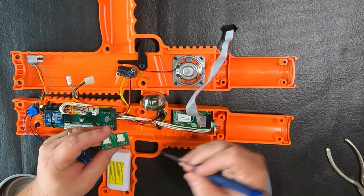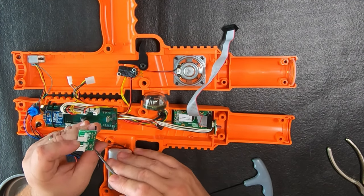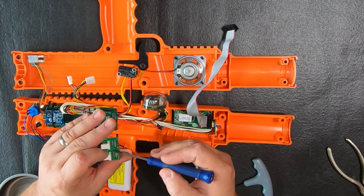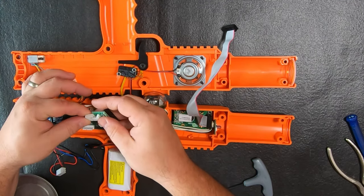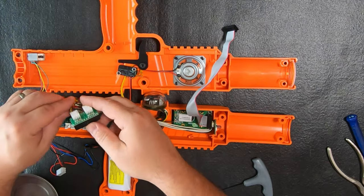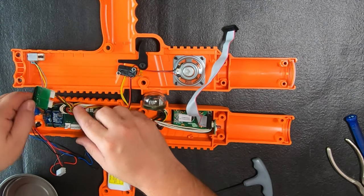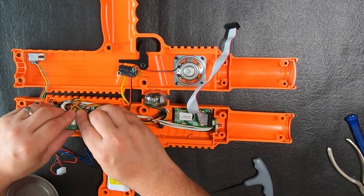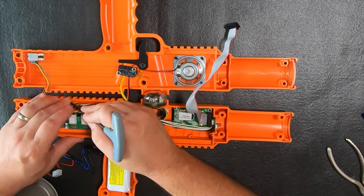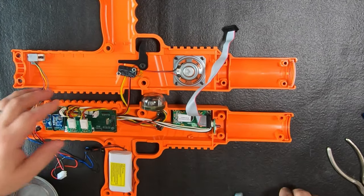Now I'm going to take my daughter boards and use my flathead screwdriver to very gently push these little resistors so that they're inside the box. This should have already been done for you, but double-check that the resistor is inside these little white boxes. Once it is, we're going to gently plug in the gun sensor and head sensor jack. Give it one or two twists depending on how much extra cable you have, just so it's neat, and then plug it into the two sensor slots. Then using the 7/64ths, gently push all these wires back towards the board, away from the edge.